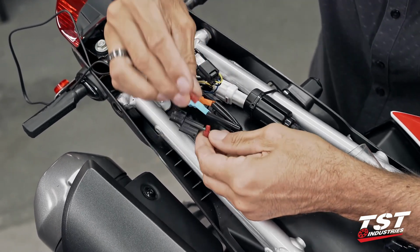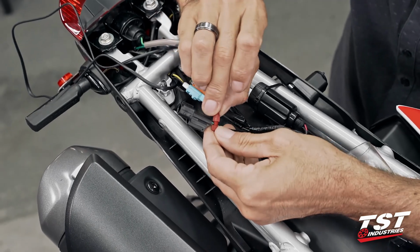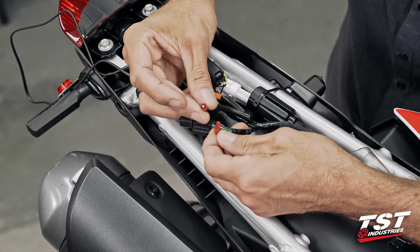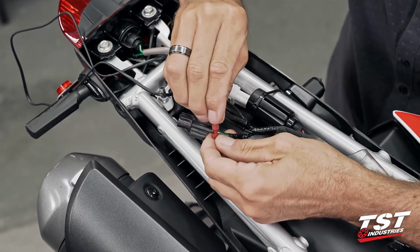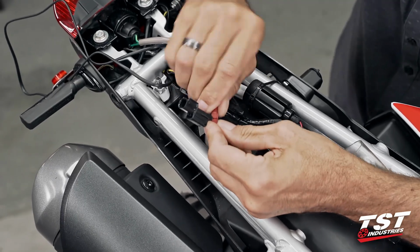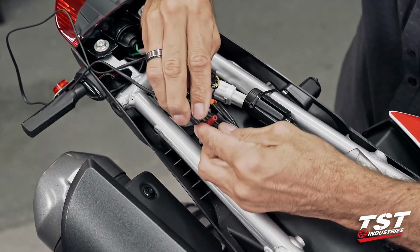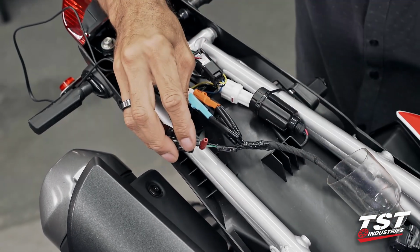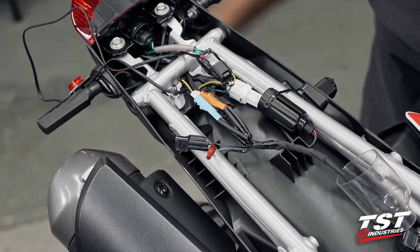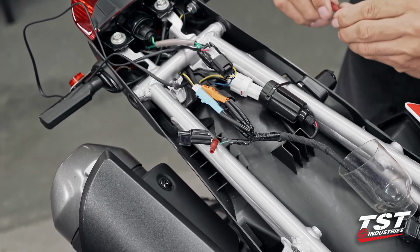And now we will screw the rest of this connector body onto this thread here. There's a little piercing element that will pierce the insulation of that wire and make the connection for us. Our license plate light is a very low current application, so it doesn't require a very big conductor at the connection. I'll repeat that on the other wire.